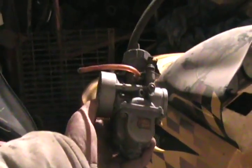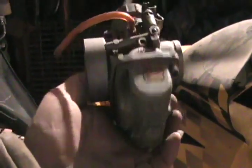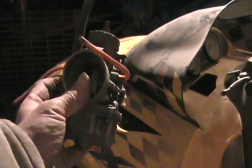The snowmobile carb looks just like a dirt bike carb for two-strokes. There are the old-fashioned Tillotson carburetors that have all those layers and diaphragms on the bottom because they're part of the fuel pump too, but more modern sleds like anybody would want to drive have a separate fuel pump somewhere.